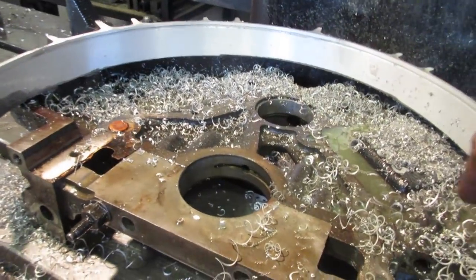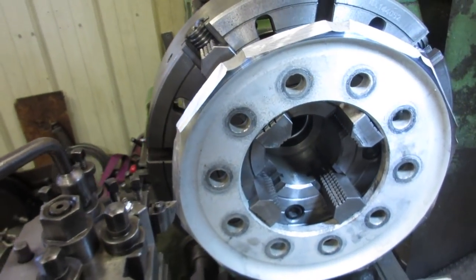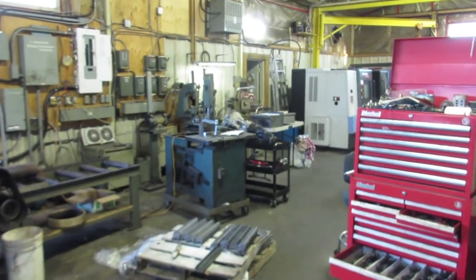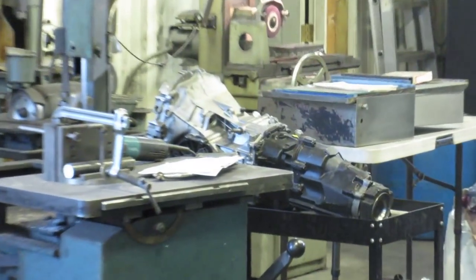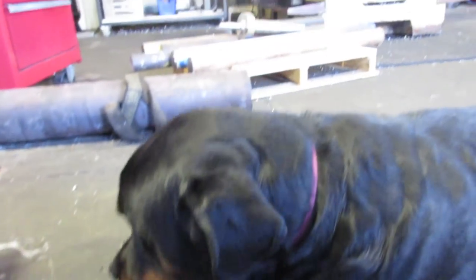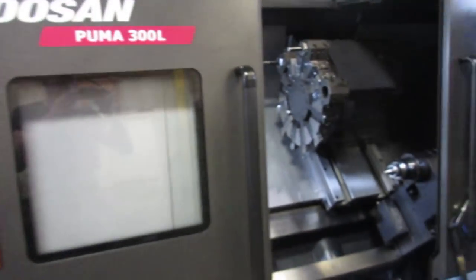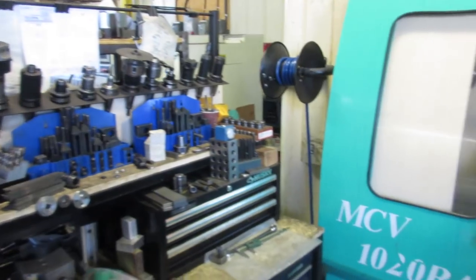So hopefully that works. So now that we got a perfect lip on this, we'll measure the inside diameter from here to here and cut the truck rim to the outside diameter of that. Then we'll measure the transmission and the outside diameter of that bell housing will be the inside diameter of the truck rim. It's just that easy. And then we'll dial indicate off of the input shaft when we're welding, just to make sure. And we've got a GM bell housing on an Audi transmission.